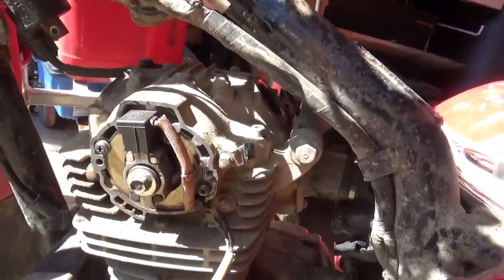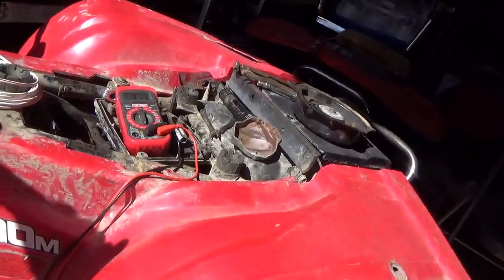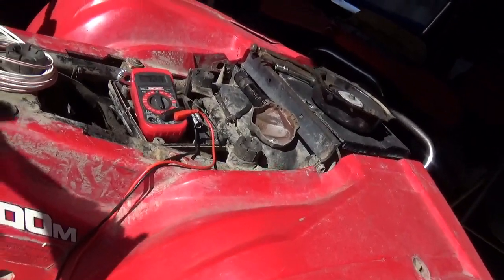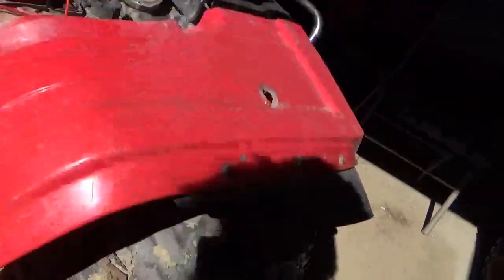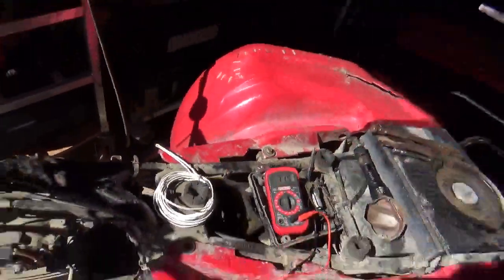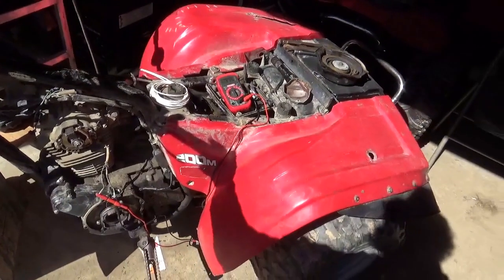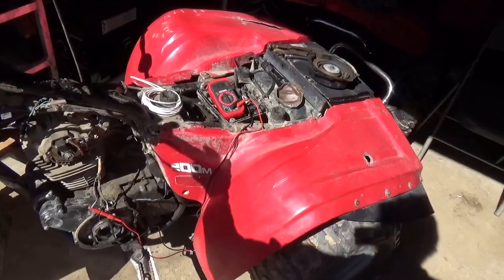It seems like what they worked on they kind of messed up. I got a little play in the wheel here too — I think that's bearings. I don't think that's the hubs; the hub's a little loose on the other one, but this one feels like the bearings are a little loose. Just something quick — if your bearings are loose, don't be doing donuts in gravel. It takes those bearings out real quick.